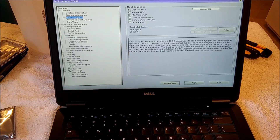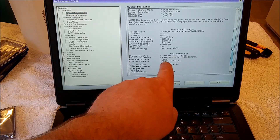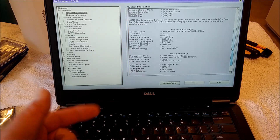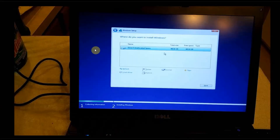Let's see if we can get the drive sorted out. I've gone into the boot sequence menu and given it only the option of mini card SSD boot — though I also want to enable USB boot as well. Those are still reversed — it's still seeing the primary as the actual hard drive. I'm betting since I've told it only to boot to the SSD that Windows will see that as the C drive and we'll be good. In Windows 10, the place to do that is the partition menu screen during installation. On my 7440 it just listed two drives, and drive one happened to be the one I wanted to install Windows on — I selected it, Windows figured it out, and made that the C drive and the other one the D drive. So in the BIOS they're still backward, but in Windows they are the way I want them.